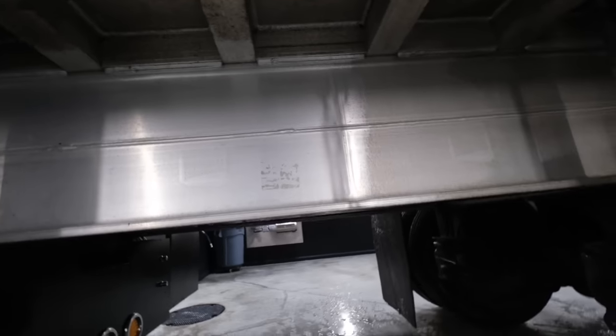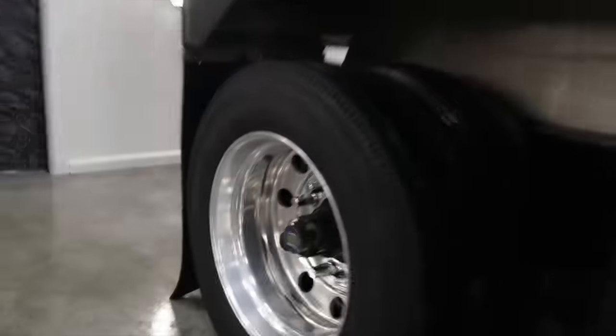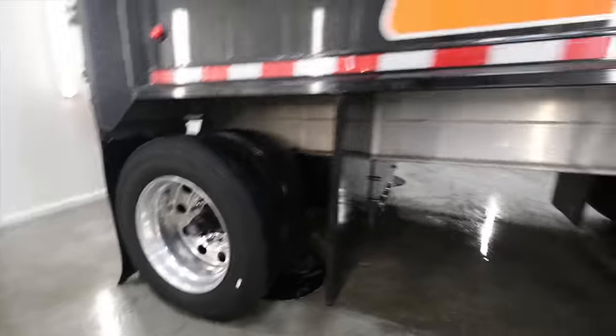We got it a little better. I mean, it makes sense, right? 50-50 is quite a bit stronger. You've got physical contact in the mix there. Now, you could do this with an aluminum brightener, and that's an etching acid, right? That would be very efficient at doing work like this, but you would run the risk of streaking any nice aluminum that it came into contact with.